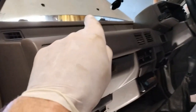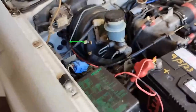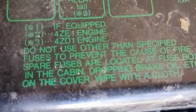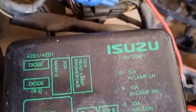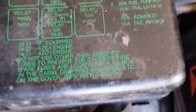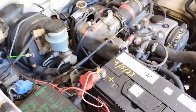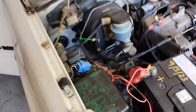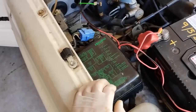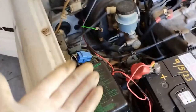The speed regulator is good. The old one was good. The fan's good. So this problem is now with the relay box - it'll be one of these relays. It might be a smart move to take your car to an auto electrician if you've got a similar problem with the fan not working, and he'll soon work it out for you. And you can replace the part.